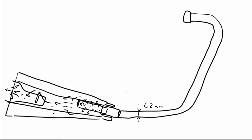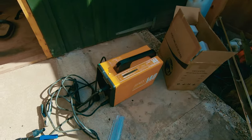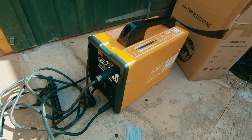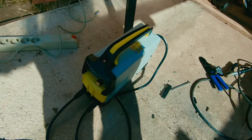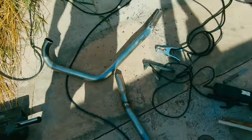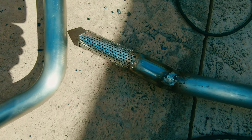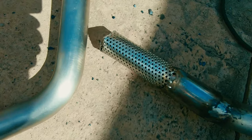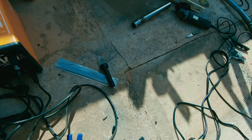That's my plan for today. So I will show you the mess here — it's work in progress. I had this welder and tried to weld stainless steel with it, which was a terrible idea, so I had to buy another one — an inverter welder. Here are my new pipes. I've cut the end of the pipe and welded an initial muffler here, something which will quiet it down. And then I will use those mufflers — I will also use that.